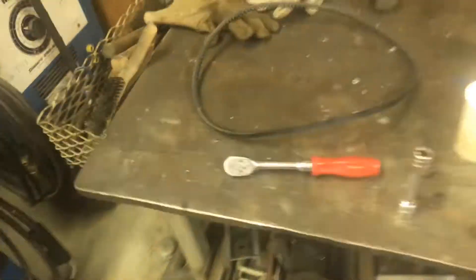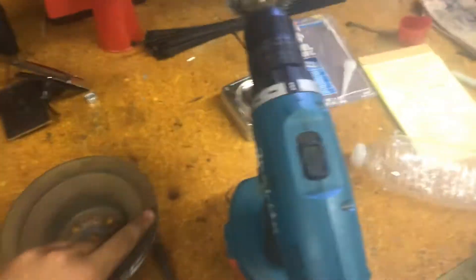The reason for this is quite simple. Here's a new belt that's gonna go on, and over here is the water pump pulley. I had to take a wire wheel and wire wheel it down so that it did not shred any belts.